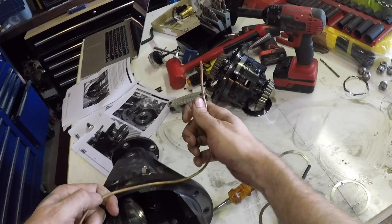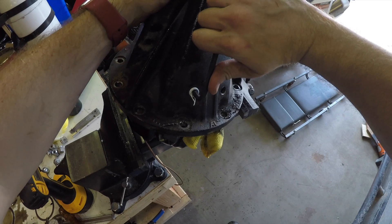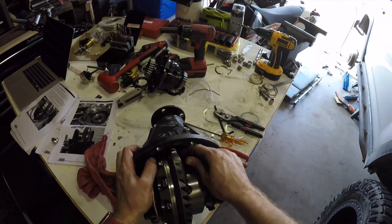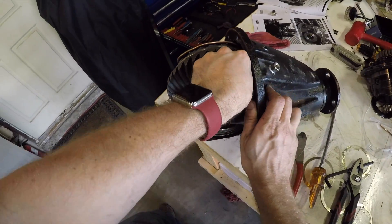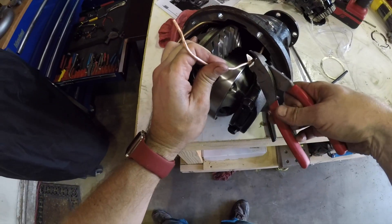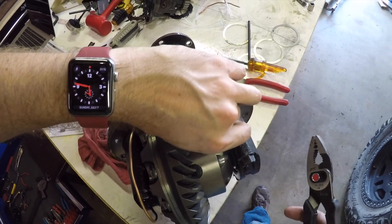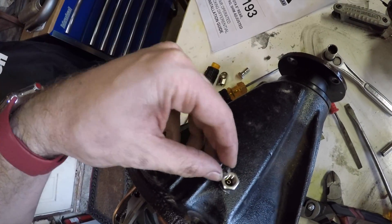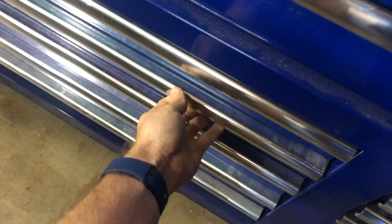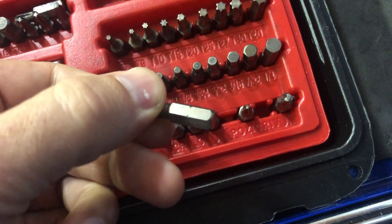Now we need to route the copper tube out of the carrier hole we drilled — this is where I find out that I drilled the hole on the wrong side. Oh look, it's right where the ring gear is. Good job, idiot. I redrilled a new hole in the correct location and plugged the old hole with an NPT plug. We need to fish the copper tube around the ring gear, so just bend it and pull it until it makes its way to the tapped hole. Make sure it's as far away from the ring gear as reasonable. Screw the bulkhead fitting body into the carrier and cut the copper tube to length. Install an o-ring, then the spacer, then the other o-ring around the copper tube, then add the compression nut. The instructions say to tighten the compression nut with a Posidrive number three screwdriver — you could probably just use a Phillips screwdriver.